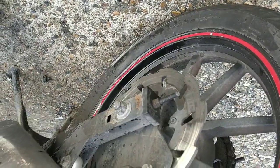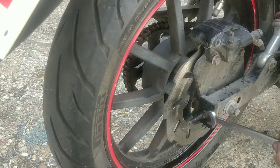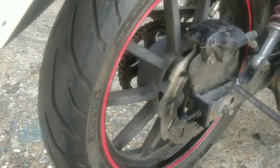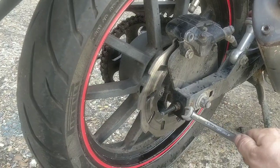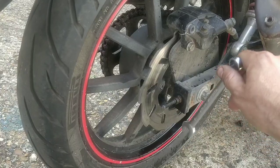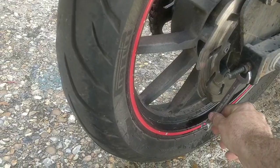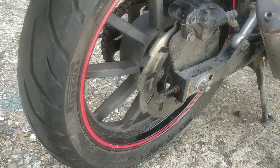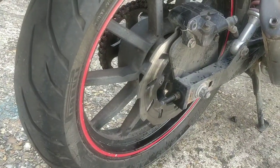and then treat it. So guys, when I said I'm going to pull the wheel back just half a turn, what I mean is loosen up the back nut, which is what I've done there. It's a 13 on this bike. Then you loosen up the main nut here, this one, probably a 17, but I've been wrong every time today. Then when I say half a turn, I'm assuming this wheel is aligned, it looks aligned. I'll do something like that, and I'll do half a turn down to there, and then I'll do half a turn on the other side, and that should pull the wheel back appropriately on both sides, and should tension the chain enough for it to be safe. At the moment it's not safe. So that's all I mean.